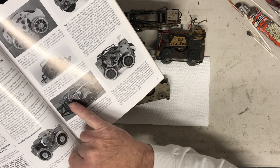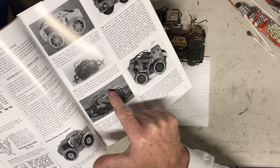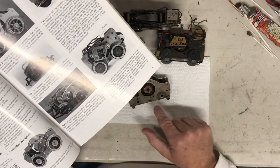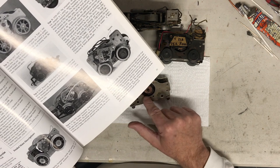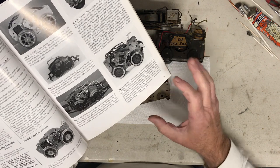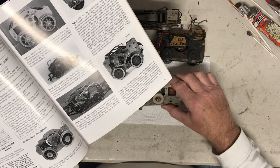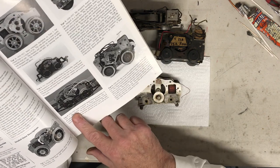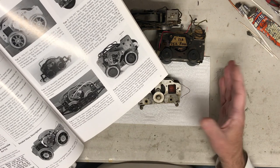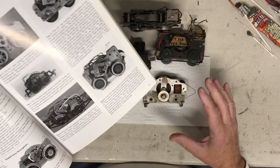you look at the brush plate that should be there, it's screwed on at two points. I have two screws at those points with threads in them. The other holes have no threads. So, something to look for when you're trying to match up information with the picture. So, I call this a T4, which is used between 1918 and 1925 on a lot of their earlier engines. So, that's how I went about this.